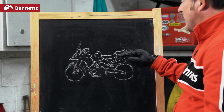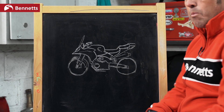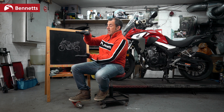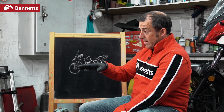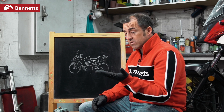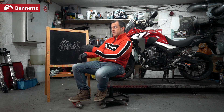Let's look at our little diagram of a Honda CB500X. When we add luggage and a pillion to the rear, the rear is going to compress. When the rear compresses, we are adding laden sag — essentially the bike sits lower. This reduces ground clearance on corners, but it also affects the front and the geometry, so the bike doesn't steer as nicely because it's sat further back.